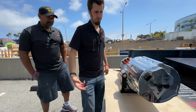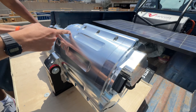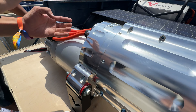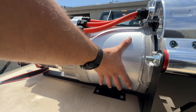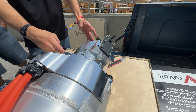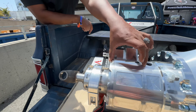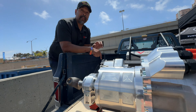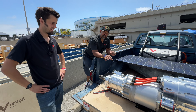This is the front — your DC in, your inverter. It has a bunch of cooling manifolds built in that distribute coolant to the inverter and all the rest of it, through the stator, and out the back here is your gear reduction box. It's a normal turbo 400 yoke, regular driveline. This is your park lock — that's an optional part. The torque box and park lock are supplied via Torque Trends. The Miata is built by Torque Trends — that's Mitch's car, and he makes these torque boxes.